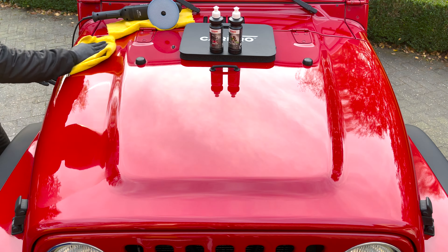It's the same process over and over again. Once you get the hang of it, it's quite simple: side-to-side and up and down in straight lines, then wipe the residue off in a crosshatch pattern with a soft, clean towel. Although it's possible to polish smaller areas like the side of the hood bulge with a full-size polisher, it's much easier and more precise to use a medium polisher for the job. This type of lightweight battery-powered polisher is also less tiring to use for a large polishing job — it won't cramp your muscles as fast.